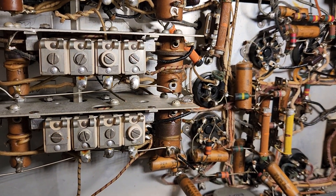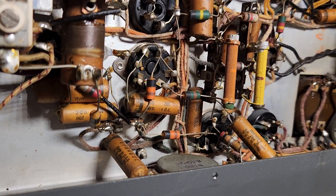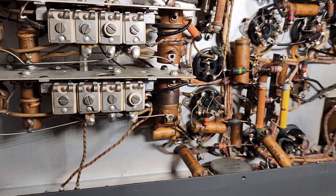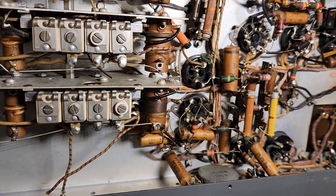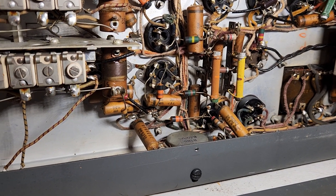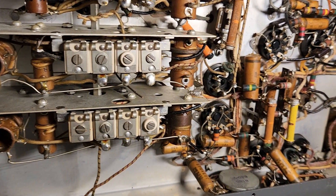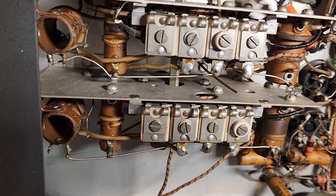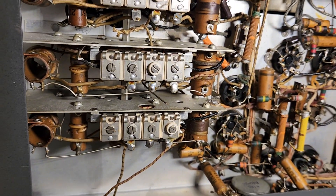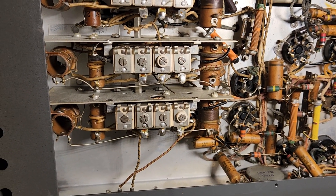So I'll have to get on to ordering parts and we'll see what we can do with this — not the least of which is a new power cord. I'm going to go ahead and buy a proper power cord so that you can only plug it in one way, with the wider blade for neutral. That will help keep this a little safer, although I'm not that worried. Everything's going through a transformer in this one, so it should be relatively safe, which is good because this is not a wood or plastic case — everything's metal.